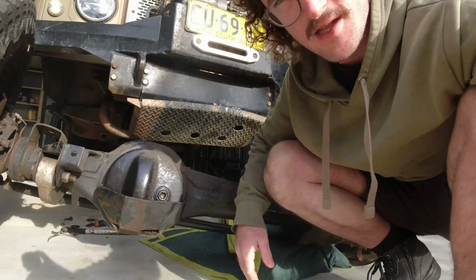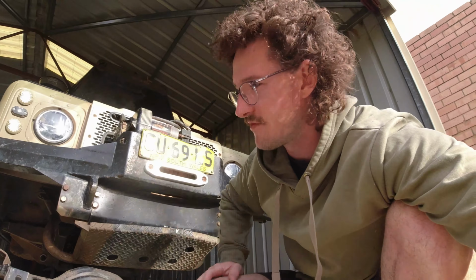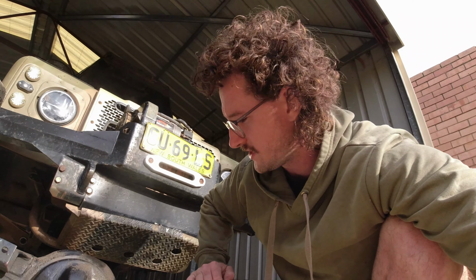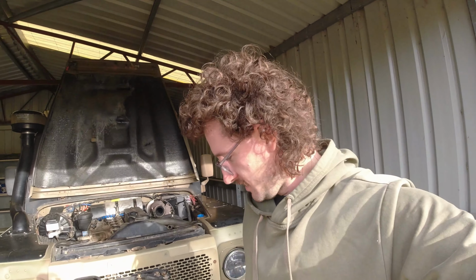So I'm going to strip off the ends, complete, just leave them as they are, and fill the housing full of petrol or wax and grease remover or something, see where it leaks out, weld that hole up, that little pinhole. It's a very slow leak, so if I clean it and put new oil in, it takes about 2 weeks to start leaking.